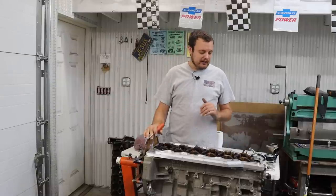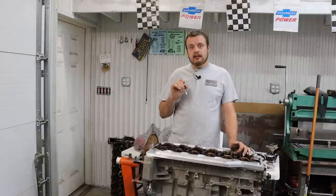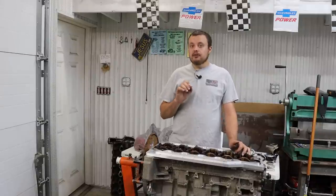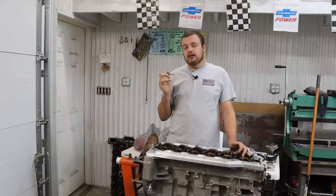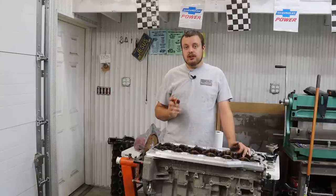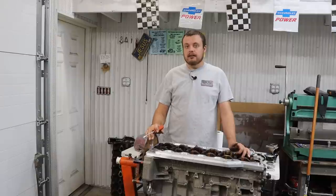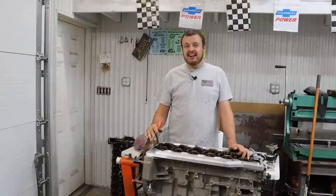These are all great, but at the end of the day, you're still going to be limited by the strength of your connecting rod. In the case of an improvement to your oil pan, what you are doing is you are reducing the amount of losses due to windage in the crankcase. You're not putting any more stress on your connecting rod, and you're able to go much farther with your stock bottom end. Therefore, I call them free horsepower upgrades because they are not putting any more stress on your connecting rod. And that's kind of our goal as a stock bottom end enthusiast.